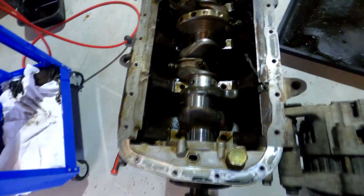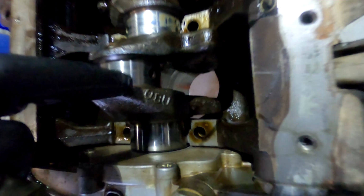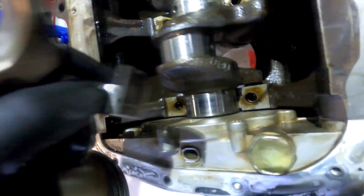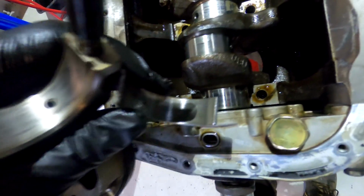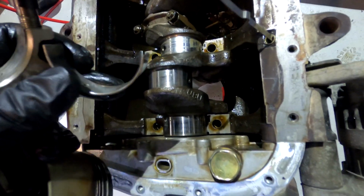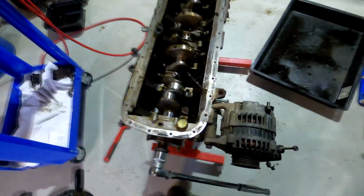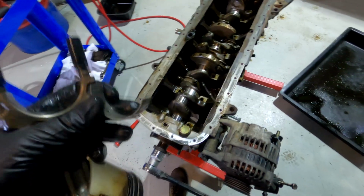What happens is oil goes through your engine, through all the oil galleries, goes into your crankshaft and then comes out this little hole here, which then acts as a lubricant on the big end bearings. So if there are any scratches or any damage on this liner at all, it damages the big end bearing, which will then cause friction between the conrod and the crankshaft, which will then affect your performance, which can then lead to further engine damage or engine failure.